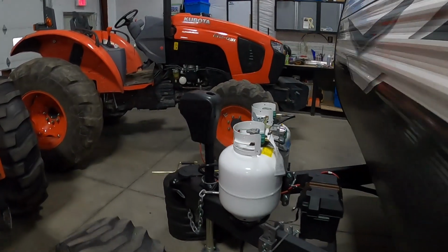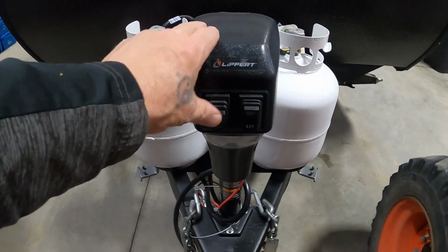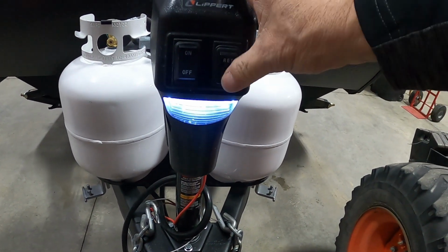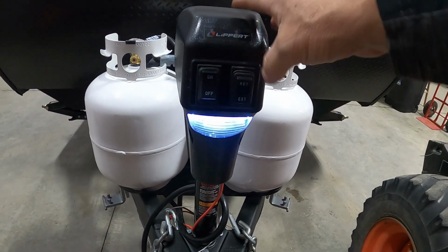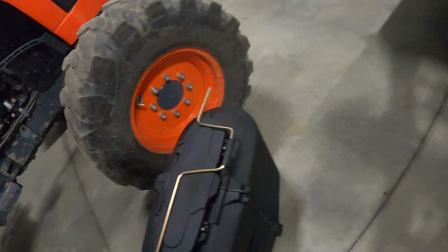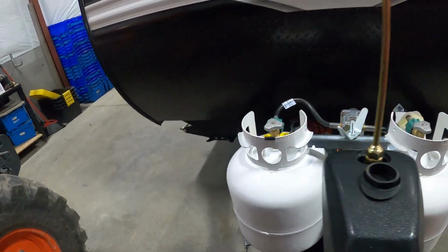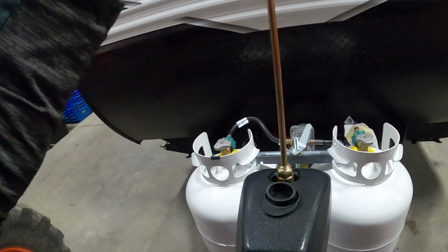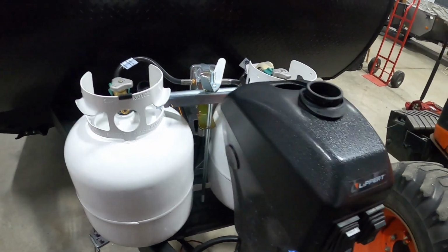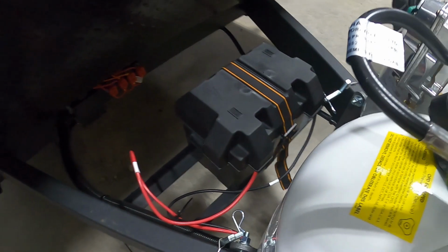Once you arrive and unhook our hitch, first thing we're going to do is level our unit. Your power tongue jack has a night docking light. Should you arrive at night, simply retract to lower, extend, or raise. Now, should you lose power, underneath this rubber stopper right here, your hand crank, which will fit here as well as your stabilizing jacks, will get this up and down without power. Speaking of power, check your battery posts every now and then. Make sure nothing's wiggling loose over time.